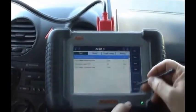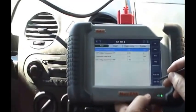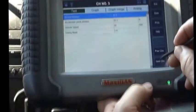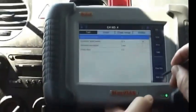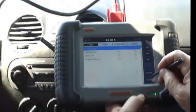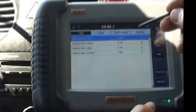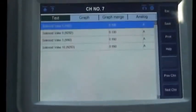So are we looking at the solenoids working right now? Right now we're looking at output RPM sensor and input sensor — we're looking at the speed. What I like to do is scroll down through all the groups so I can see how everything's working. Okay, so now we're coming up to the shift solenoids, and you can see as the transmission shifts it starts pulsing milliamps through the system. We're coming up to a stop now.